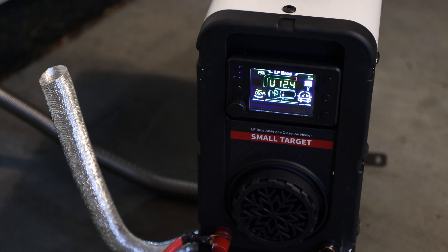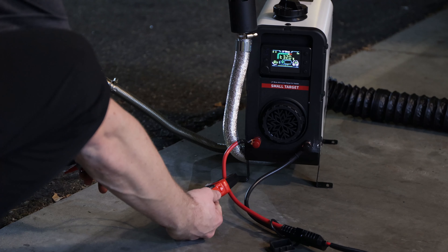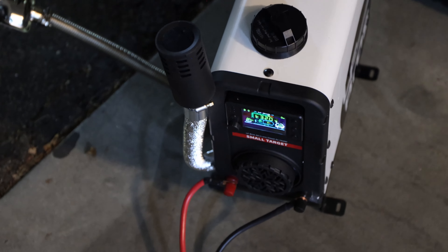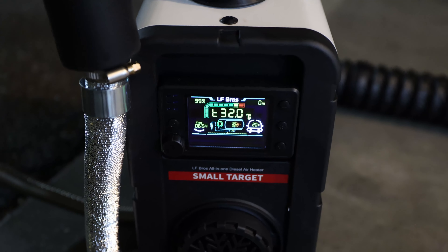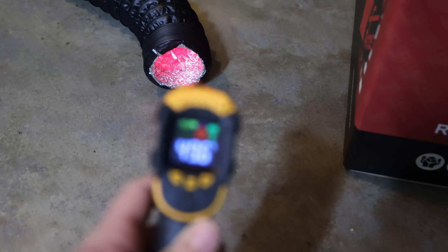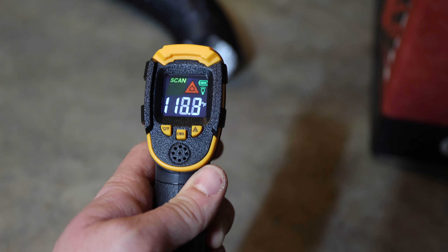There's a lot of information on the display and I'm still learning it myself. It also has a timing operation. Right now we're looking at about 3 to 3.6 amps during operation. I also installed a filter — very important, you should do that before you start it. This is the intake side where I mounted the hose. Right now we're seeing around 50 degrees Celsius / 120 degrees Fahrenheit coming out of the hot air outlet.